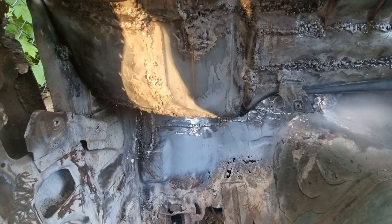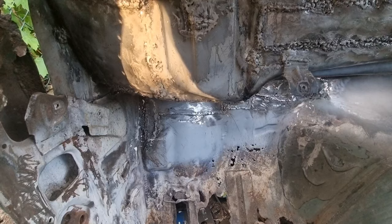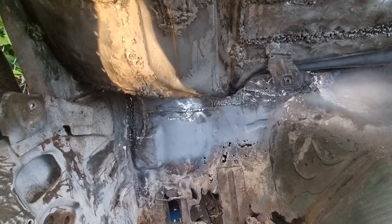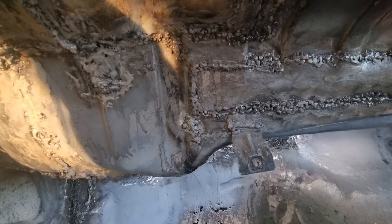I think before I was doing pulse welding — pulse trigger welding — where you just pull the trigger, let go, pull it, like that as you go along, but you don't get that kind of weld. And yes, before anyone says it — that weld is going through the other side; I've had to grind it down on the other side. Hence why I've got to redo my fibreglass because it went straight through on the other side and burnt all my fibreglass off.